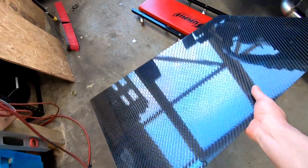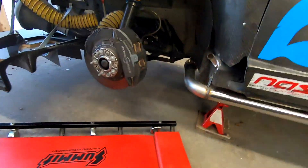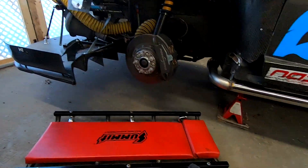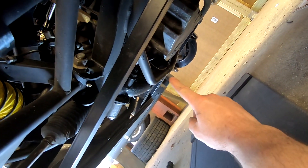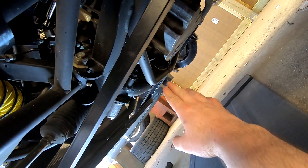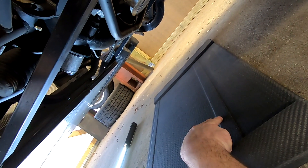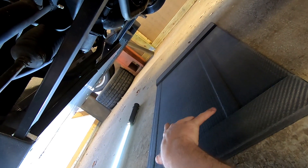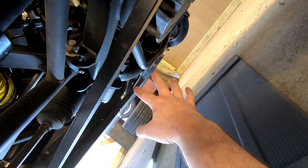First I'm going to get underneath the car and do a test fit to make sure it clears everything. That way I can pull the whole splitter off the car and mount this to the splitter frame off the car — it'll be a lot easier. We should be okay, though this does end up touching a little cross beam right here. Once we bolt this onto the splitter frame, there will be contact there, but that's kind of why we made this thin in that area and added extra thickness around the sides. We kind of have strength where we need it and not necessarily where clearance is tight. I think we'll be okay. We'll pull the splitter off and get this mounted to the splitter frame.